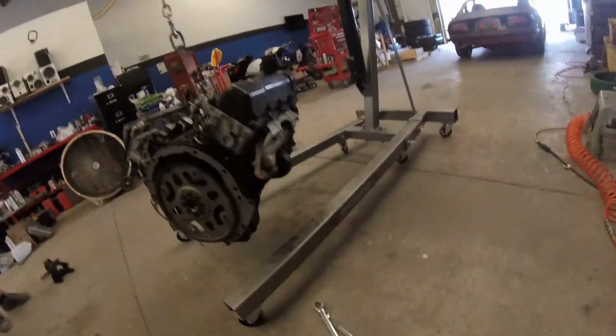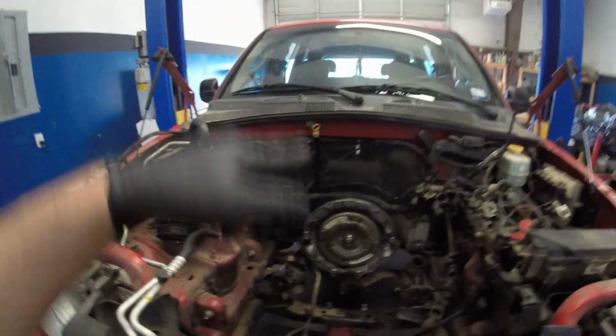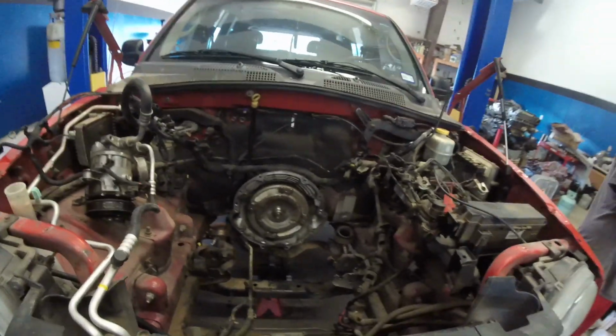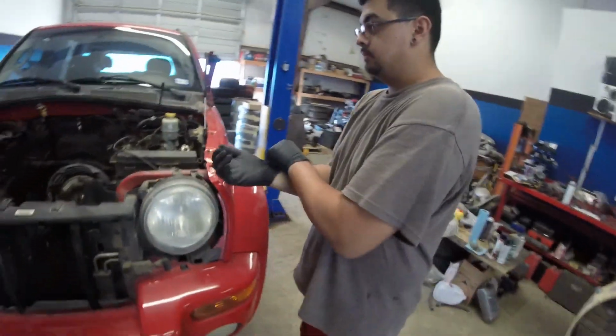Okay, so the motor mounts are on now, guys. I had to drill out the holes a little bit on that one to get the holes to be precise to get the bolts in. Got the transmission jacked up so it bottoms out up on the tunnel. So now ain't nothing to it but to do it. I'm gonna raise the hoist and stab this bad boy in there.